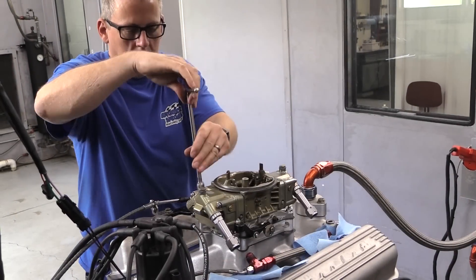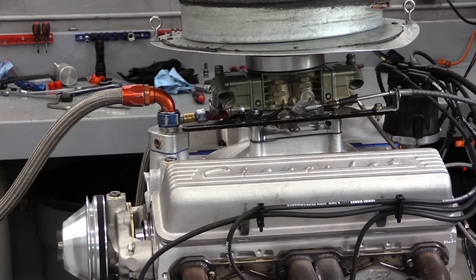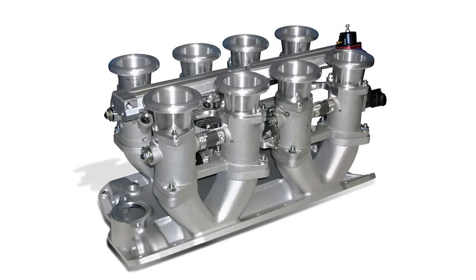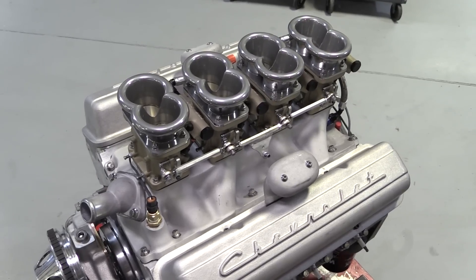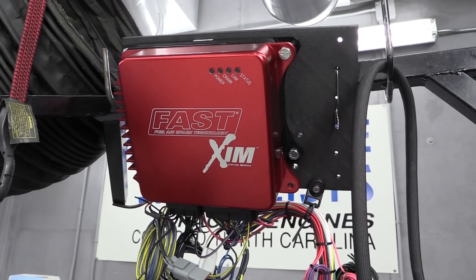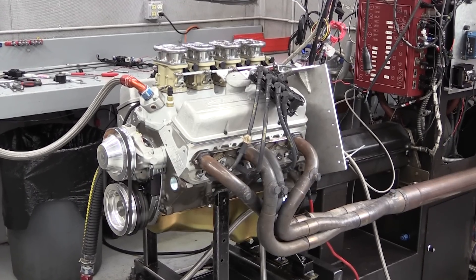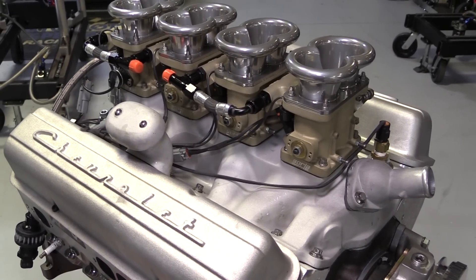A lot of people don't want to believe it, but a properly sized and adjusted carburetor can make just as much peak power as electronic fuel injection — and that's been proven here. The throttle bodies just weren't set up to flow as much air as a big double-pumper, though a set of larger Borla Chevy-specific throttle bodies could close the gap. Still, there's a lot to love about this system: unlike old four-deuce carb setups notorious for being hard to tune, the FAST self-learning EFI had none of those headaches. It will also crank easily on cold days, save fuel, extend engine life, and provide great throttle response — plus the look of those throttle bodies on a small block is pretty tough to beat.